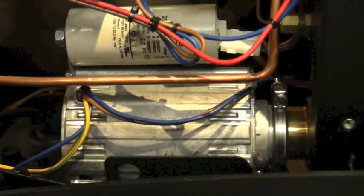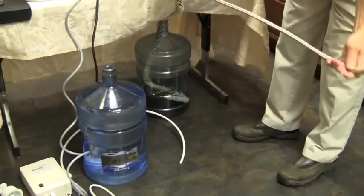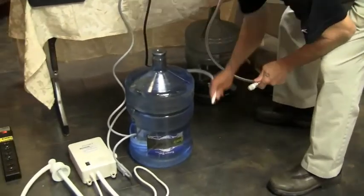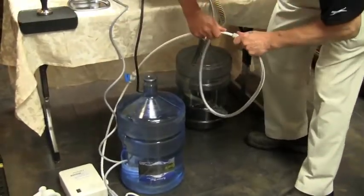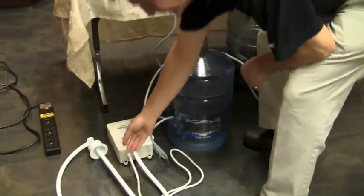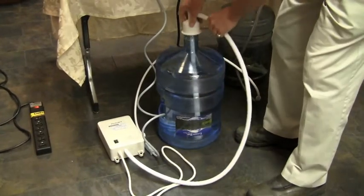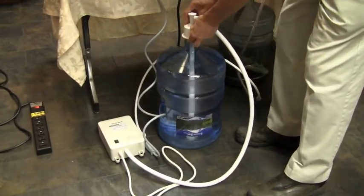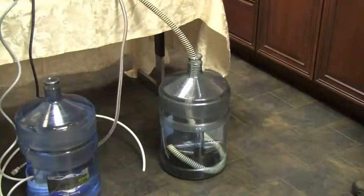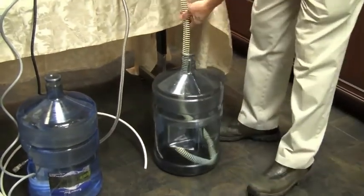The Appia has a rotary pump and motor and must be connected to a water source. When we use the Appia at charity fundraising events, we simply use a flowjet demand pump and 5-gallon bottle water, no need to direct connect to a water source. The drain hose we simply put into an empty 5-gallon water bottle.